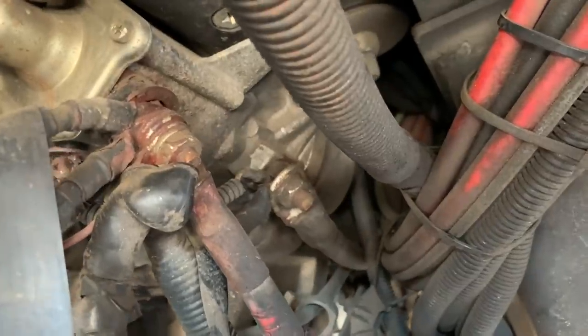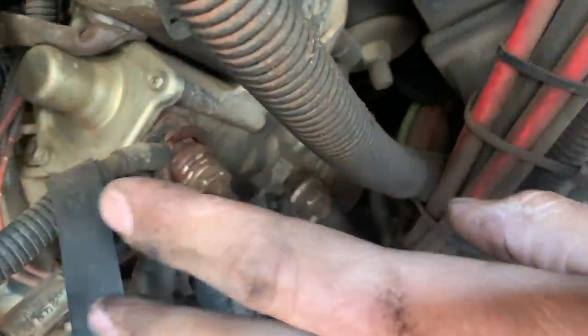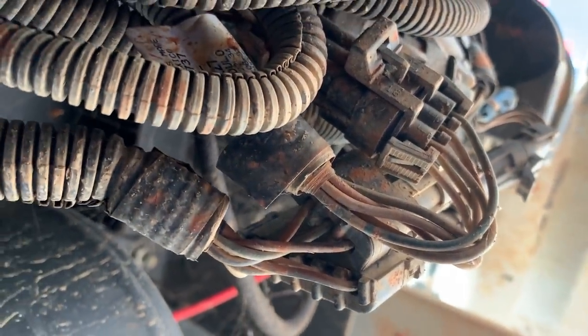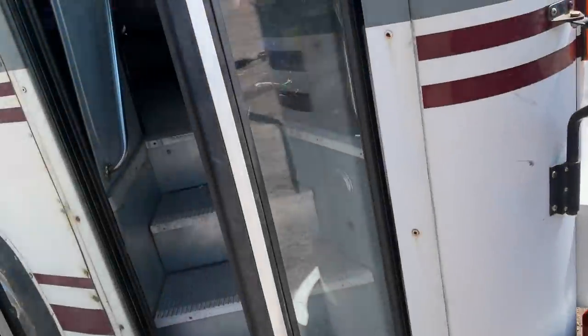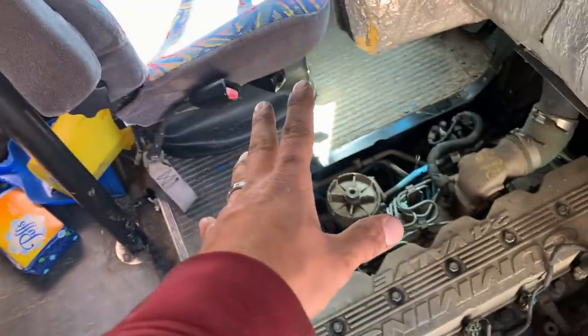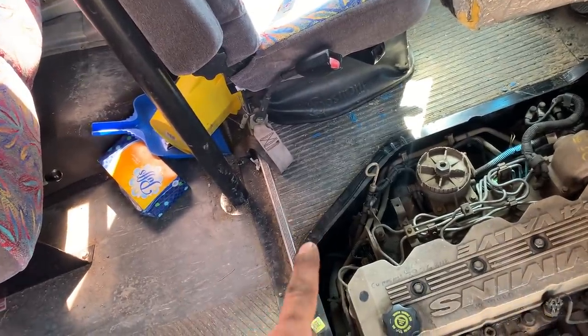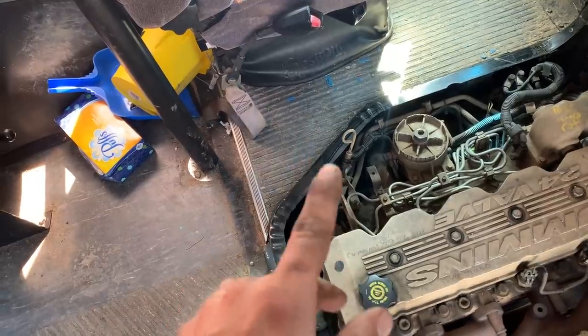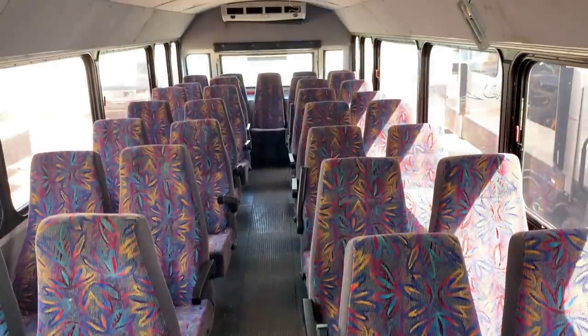I'm really happy about the block not being seized up. I was able to turn it by hand and I could feel the front belts moving, so we should be good there. Down to electrical, possibly starter issues. There's plenty of relays, fusible links, and plenty of wiring in this thing — wiring for days. I'm gonna grab the multimeter and dig into it. Update: wiring's checking out. I got a solid 12.4 volts from the battery and 12.4 volts at the starter. It seems like we have enough power, so I think we're down to a relay or the starter — I'm betting on the starter.